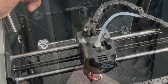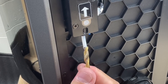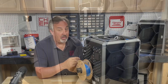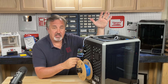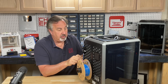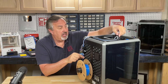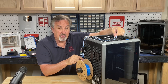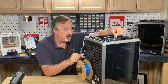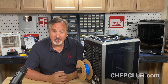After this there's one more step: take the drill bit and drill a funnel into the piece that goes into the sensor — it'll make it a little easier to load filament. Now you're ready to load the filament. Take the top off, hit unlock on the extruder, and now it should be easy to slide filament through the filament sensor all the way into the extruder. Hold the PTFE tubing a bit straighter so it goes into the tube nicely. When you get there you can feel it go right through to the nozzle. Lock it in and you're ready to print.